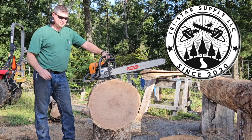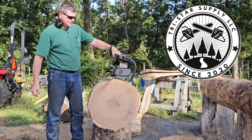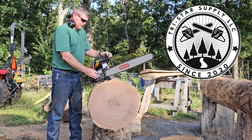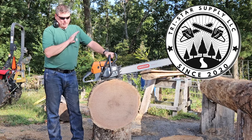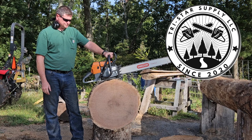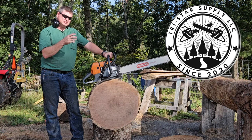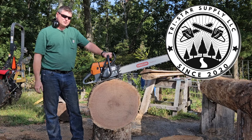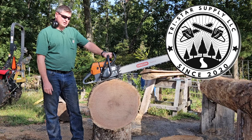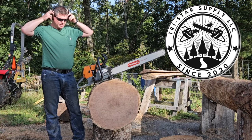Okay, so here we are again. The stuff looks stellar, especially the dogs, I think. They look great. I like the muffler mod as well. And like I said, the greatest thing about those muffler mods with these Stihls, about anybody can do it. The only thing that's hard is cutting that big shield out from inside the muffler, but you can figure it out. Get your rotary tool, just go at it. You just gotta grind it out and everything. So let's see how she runs now.